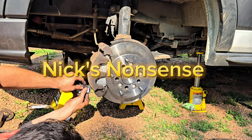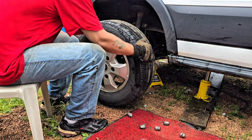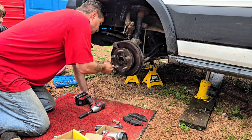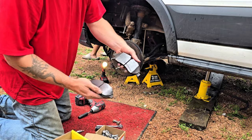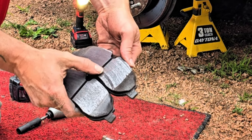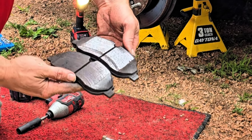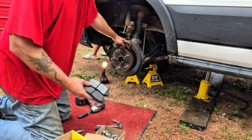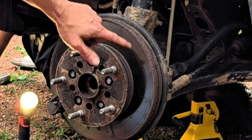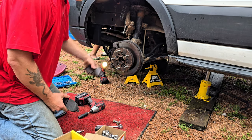What you see here is the backside of the brake rotor wearing into the brake pad, quite a bit. The front side is not doing that — front side looks really nice, got a nice tiny contact area. The backside has this rusty area that goes up to about there. Hoping that's what our noise is. So for now we're putting it back together and buying some new rotors.